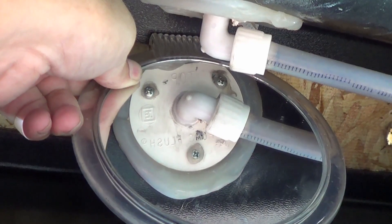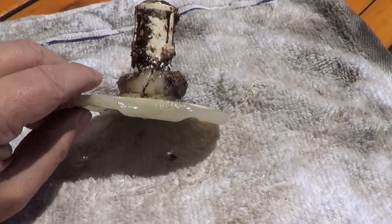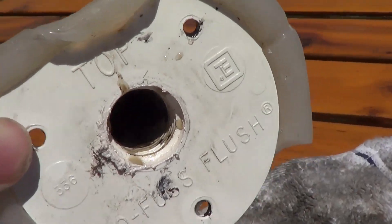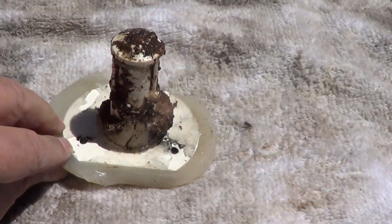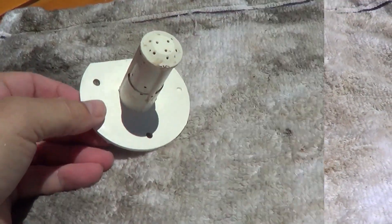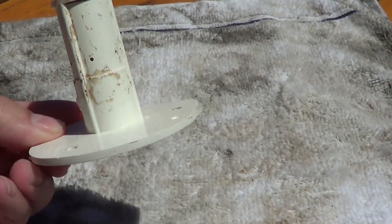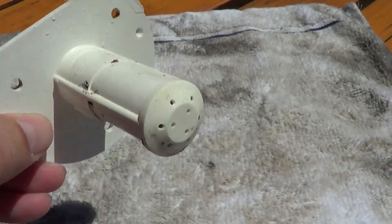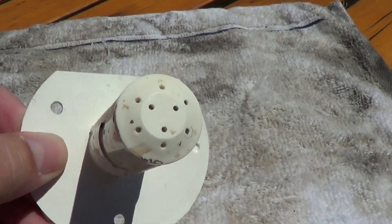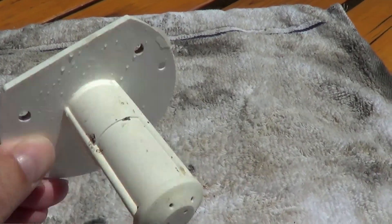Not the nicest job — I'm sure when I pull that out it's going to be a mess. Okay, got her out. Looks like it's quite plugged inside there. Well, we'll clean it up and see if we can get her working again. Okay, got it pretty cleaned up. You can see there's some holes at the end there and then a couple holes on each side, nothing on the top. So I think what I'm going to do is take a really tiny drill bit and maybe ream those holes out a bit just so they're all totally clear.